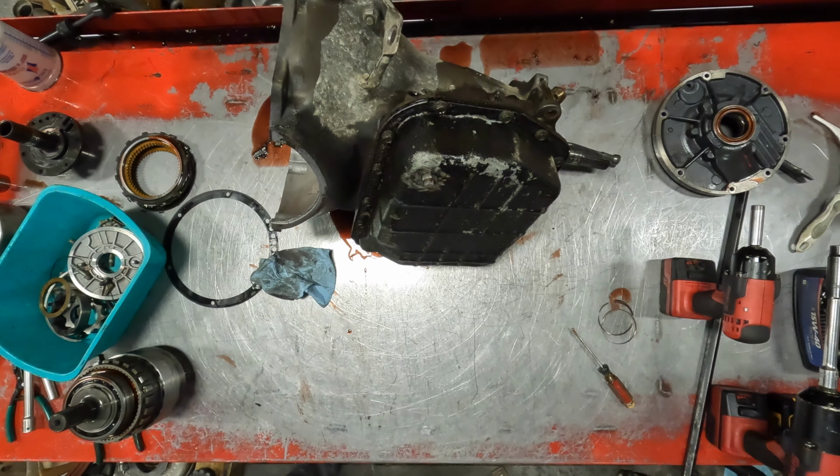Here's our high gear clutches, direct. My God, it's got a thick plate in there, and it's still only running four clutches. We'll put a thin plate back in, we'll get five clutches. So, still four clutches in the forward.